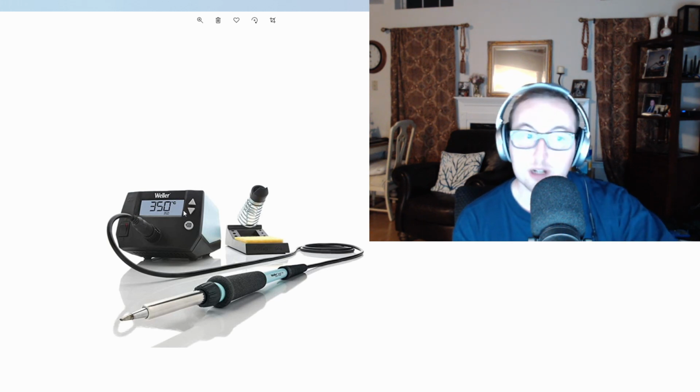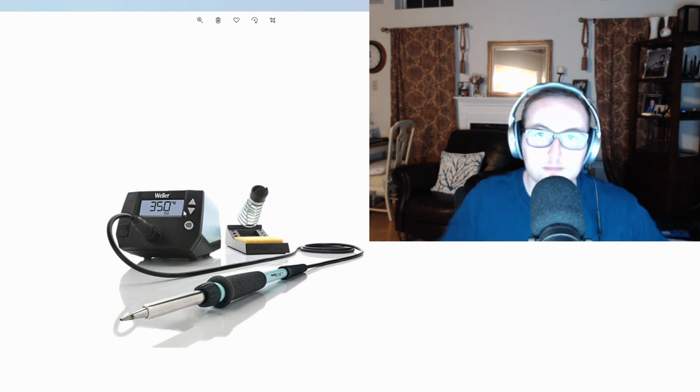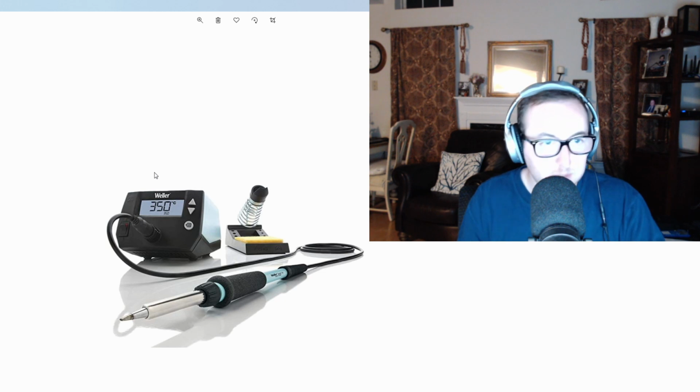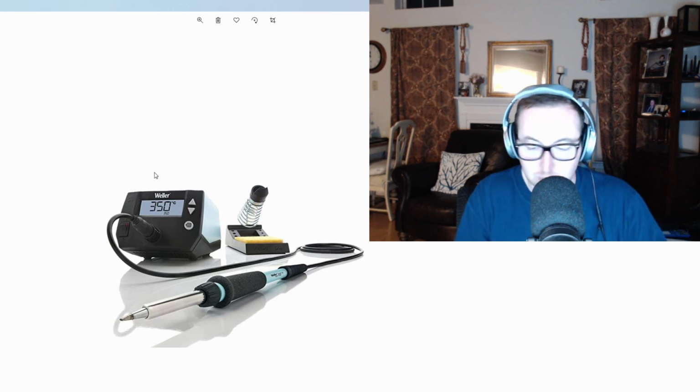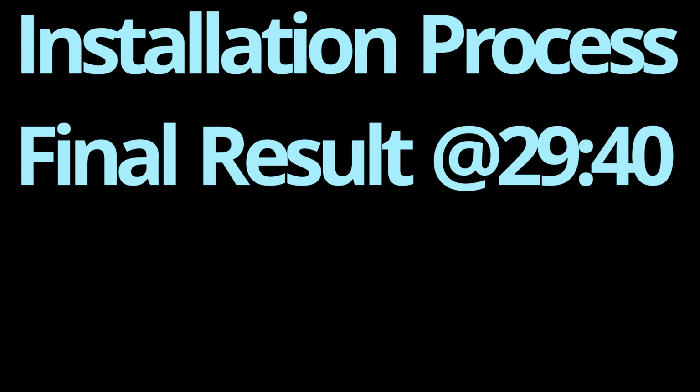And also, if you want to do the brightness controls, there is one extra wire you have to solder if you're interested. And that's it for the parts. It's very simple. It's take the old one apart, put the new screen in to the new case, and then swap all the parts into the new case, and then just attach it. It's plug and play.